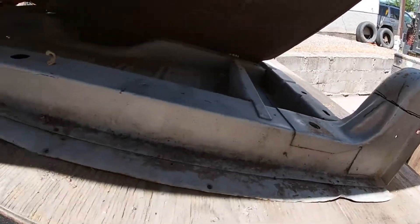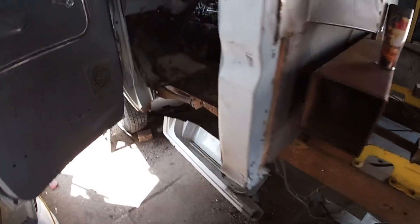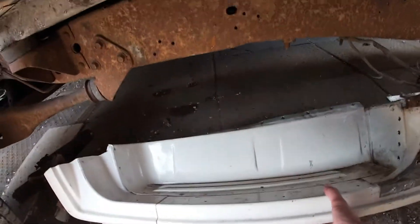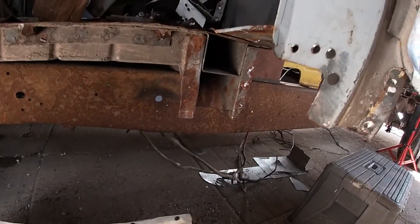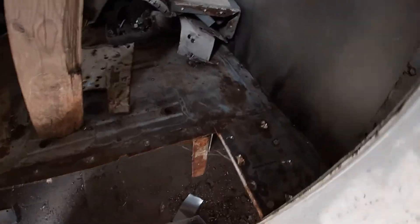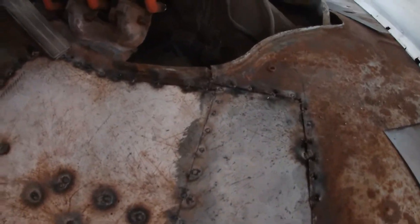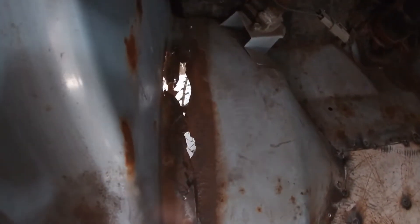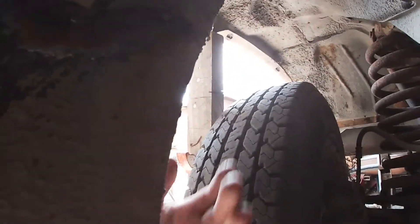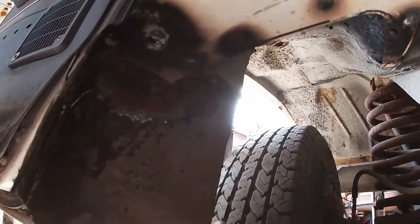This is the lower mount of what's left of the floor. We're getting to a point where I can almost fit this lower step now. Since I had it in there last night, it started getting too dark. Constantly running out of time. But this piece is all tacked in and welded down. We'll do final welding when we're all done. Found some more holes — I can't believe it. So many holes all of a sudden, and finding more holes up in here. It's not exactly the greatest situation chasing rust.